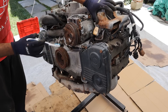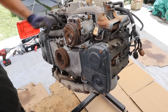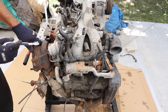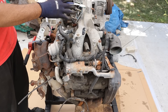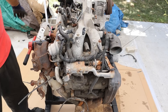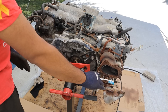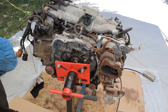At the top we have the intake, and coming off the bottom of the head is the exhaust that runs over to the other side. Coming around the side we've got your cold air intake which is going to bring cool air to the turbocharger. The turbocharger is going to use the exhaust gases to spool up and pressurize that air, then feed it to the intercooler which normally sits on top, and then down into the throttle body which will forcefully feed air down into the cylinder head. Now coming around the back, this engine does sit longitudinally — the transmission bolts up here and the front axles come out this way, which means most of the engine's weight is actually in front of the front axles for a nose-heavy car.